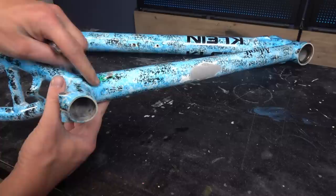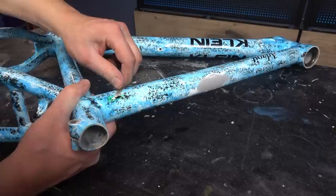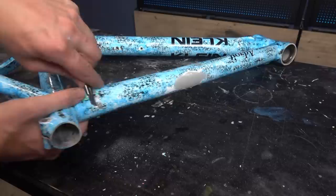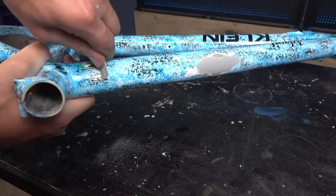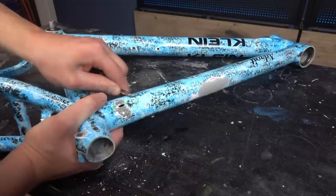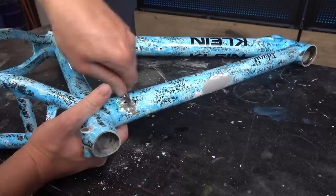The dent is filled with liquid metal and I have a smooth top tube. But there is also a big issue at the cable entry — corrosion, and it's much bigger than you think. It's all over this area and it's underneath the clear coat and the primer. That's corrosion of the aluminum — there are bubbles, and the aluminum reacts with salt, causing these bubbles. You can see it's black; normally it should be light and glossy. I have to remove all the loose color, all the salt and the aluminum corrosion, because if I don't it will come back in a few years. For the paint job to last, I have to remove all the salt underneath the primer and in the aluminum — you can see it here, that's all salty.